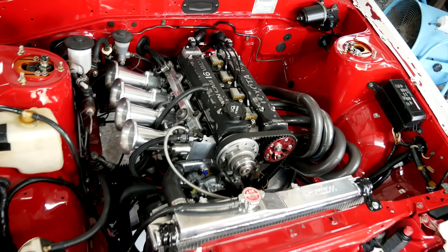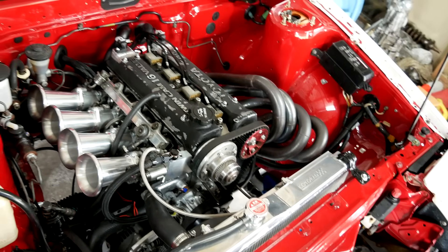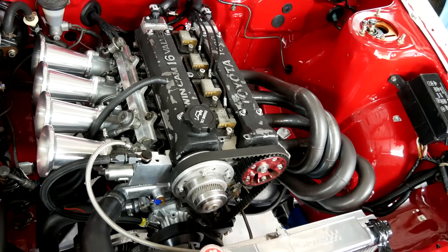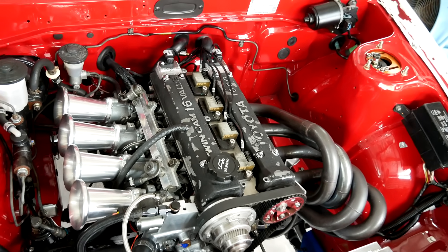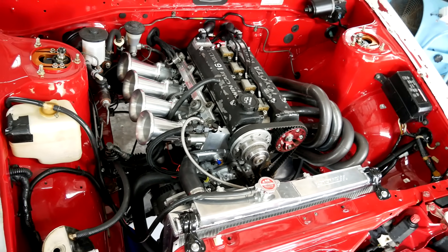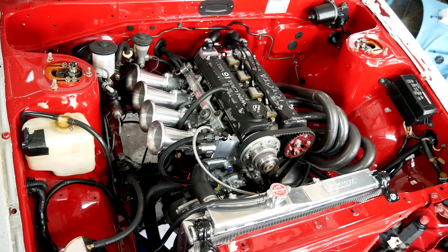It's a few days later, and I have it up and running with a VVTi setup. It has a few hand-me-down parts off my car, and a few new parts. He's going to give the cam covers and the likes a tidy-out for a later date. I set these up so max VVTi advanced is the minimum piston-to-valve clearance, which means every setup is different depending on the cams and the pistons. I've guessed a VVTi map, which I'll use as my new baseline to dial in the VVTi.